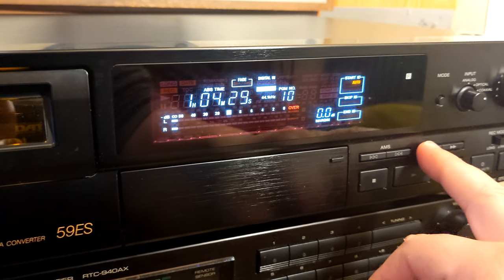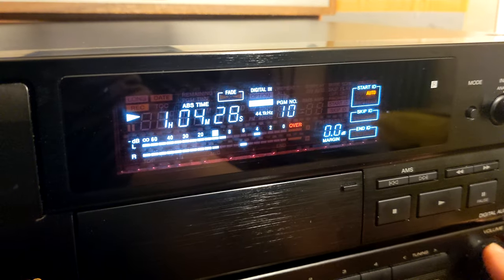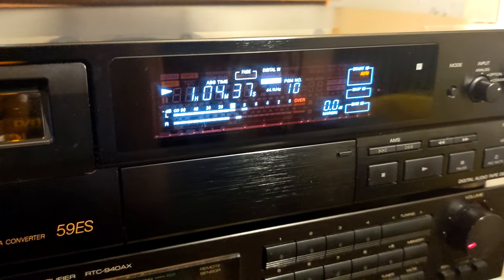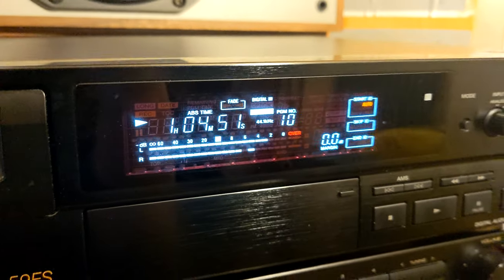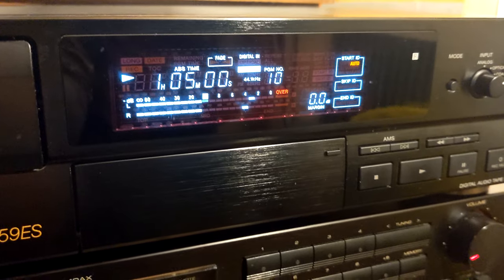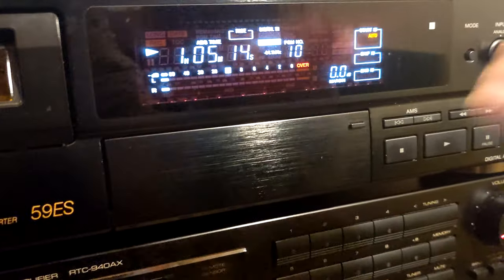It's some jazz music and I think I'm in the middle of the process. I think that should be the end of that track — yes, we are at the end. One thing you should notice is that the DAT sounds like a commercial recording. When recording from digital input, like I'm doing now via coaxial digital input, I cannot choose the frequency — it's going to be the same as on the CD, which is 44.1 kilohertz. But if I was recording an analog signal, I could choose 48 kilohertz or even use the long or standard record mode. Okay, now that's the end of that track — I'm going to put it in record mode.